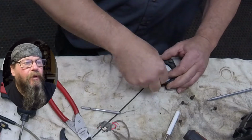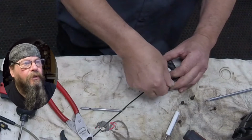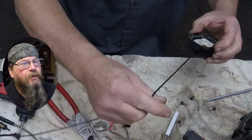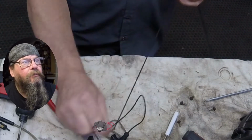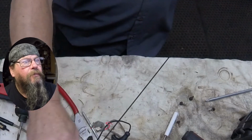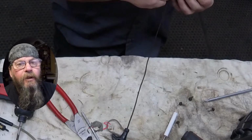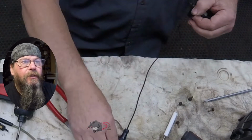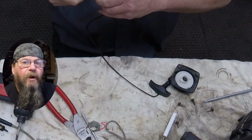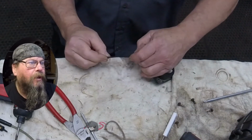There can be a little bit of fumbling getting this rope into the notch and preloading the spring, but you'll see that we're winding the spring counterclockwise in the direction of the hole in the cup. And at that point where I have my hand now on the rope, when I pulled it all the way out, I saw that I wasn't bound against the spring. If I were to pull the rope farther, the spring would unwind farther. I'm not bottomed against it when the rope's all the way out.